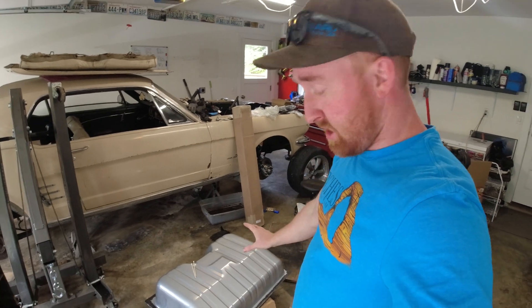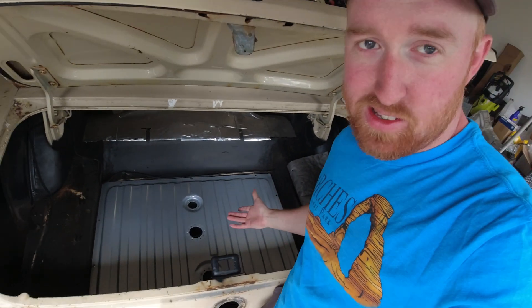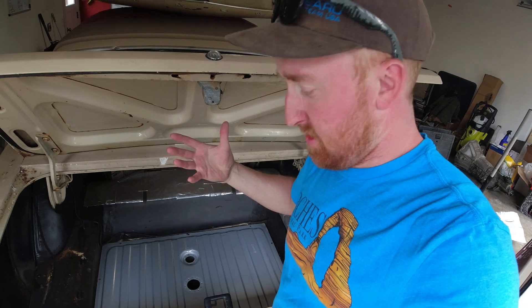It's been 24 hours now. The rubber gasket sealer I put on the fuel tank is really, really dry and solid. I smoothed it out pretty well — it keeps the aluminum from touching the steel, because steel and aluminum together creates corrosion a lot faster. So let's get this in there. You set the fuel tank in through the trunk on top and it screws in at the bottom, so it holds nice and tight right there — and it's in.